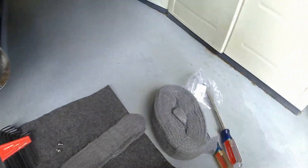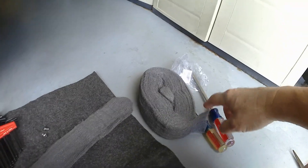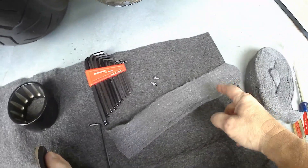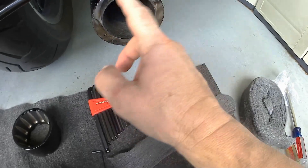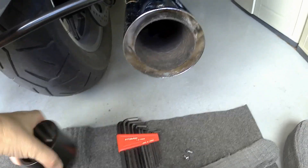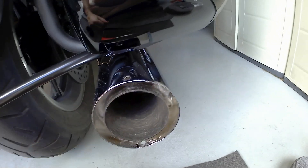Again, stainless steel wool - not regular steel wool, guys, unless you love rust, and I don't. It comes in a nice little roll. I went ahead and cut off a piece here, and I'm going to fold that up so it's kind of like a bead - we're going to go ahead and push that in. Then when we put the cap back on it has a little bit of a lip that'll push it in a little bit deeper, and that should prevent any of this packing material from making its way out again.